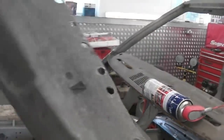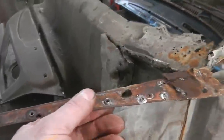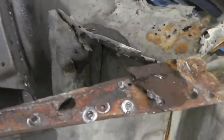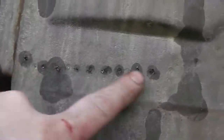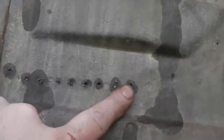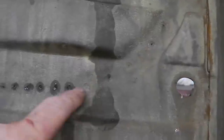Okay, with this bonnet hinge plate removed, leaving a pretty good A-panel top. Nice, still solid there, so we're good there. I like that. Now we've got to get the rest of the bulkhead out. The remaining run is along these spot welds at the front. And then on the inside, you can see where we drilled through that area there was the inner mounting plate for that bonnet hinge bracket, so it's triple welded through there, or double through. We're now on the A panel, then a continuous arc of welds up, and that's it along that front. So probably about 30 to get off, and we should be able to extract the remains of that old knackered bulkhead. We're going to pilot these out ready for the hole cutting bit.